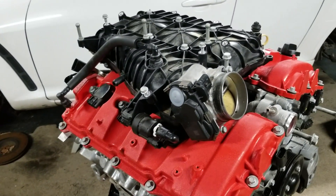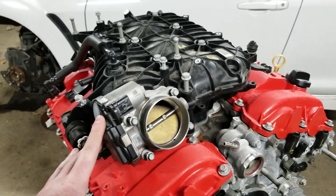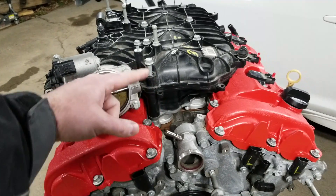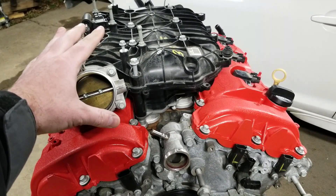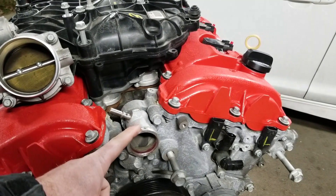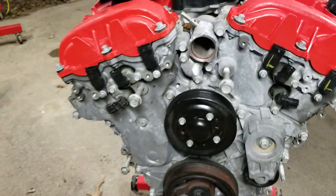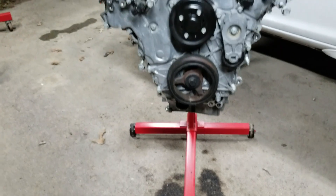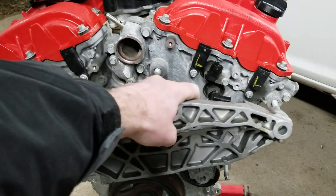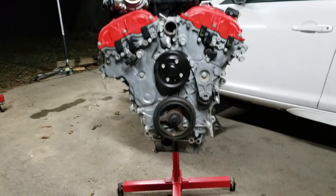The first major difference is the intake manifold. On this one you can see the throttle body is offset to the left side. The Camaro intake manifold actually has the throttle body right in the middle and brings it down a little bit lower. In order to put the Camaro throttle body and intake manifold on here, you have to replace the water outlet in the front because the Camaro throttle body will get in the way. There's a new water outlet that bolts in here and brings it down a little bit lower. Also, this support bridge — part of the engine mount system — you'll just pull that off; you don't need it in the rear wheel drive setup.